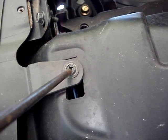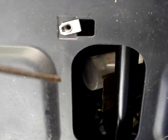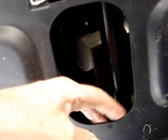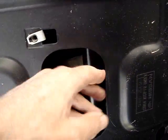They're all machine screw threads - they fasten to speed nuts, those things called speed nuts. So you've got six across the front and two at the rear, that's eight on the main skid plate. On the oil filter access plate there are only two bolts for that little plate, in case you want to do your gyrations and get yourself scarred up. There are guys online in the forums talking about cutting their wrists on this. In the four-by-four model the plate may be metal, but this one is plastic.